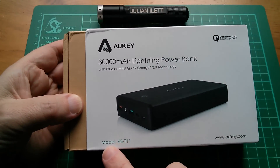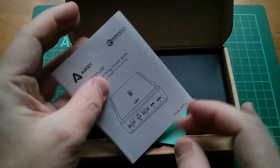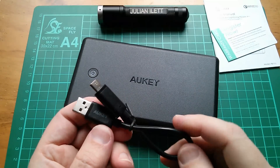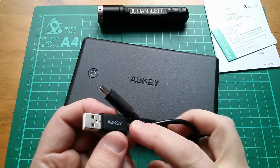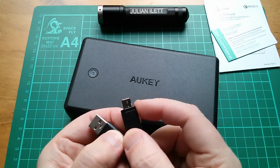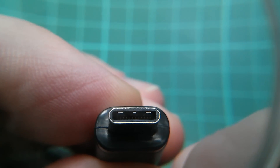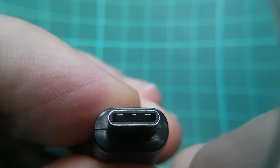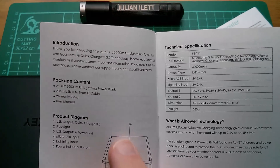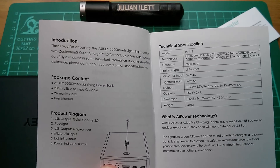This is model PBT11. Let's do a very quick unboxing — here we are with instruction manual, registration card, and the power bank. Also in the box is this cable. It's very short — it's a branded USB on one end, but that doesn't look like Lightning to me. That actually looks like USB-C. You can just about make out the 12 connections along one side and 12 along the other — it's a 24-pin connector, so this is indeed a USB Type-C plug. The manual confirms you get a 20 centimeter USB-A to Type-C cable.